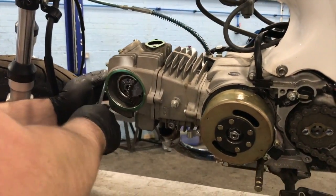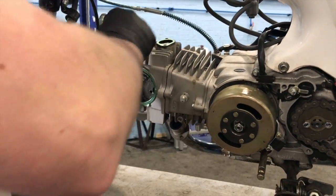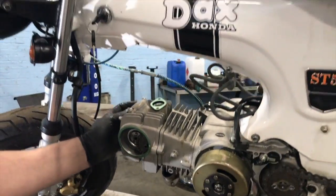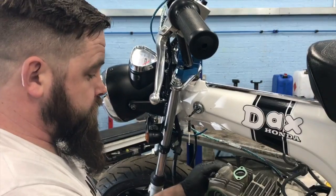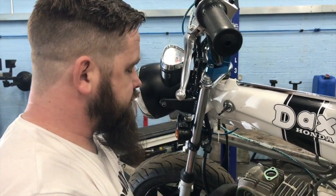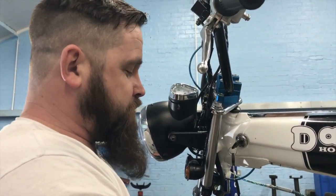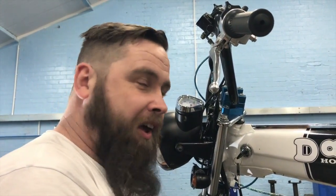And we're undoing these head bolts. One of these pulls the oil up from the pump, or whatever feeds the oil up through the cylinder head. It comes up through the galley, through one of the bolts. How do you know this, Simon? Because once I changed the nut on it and didn't put a copper washer on it, it pissed oil out the end of the head.